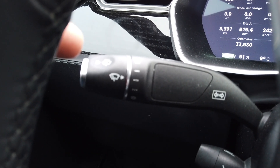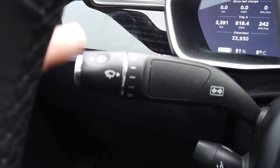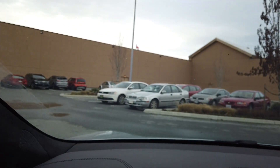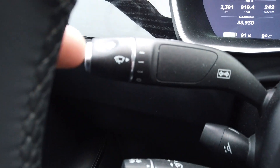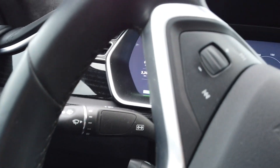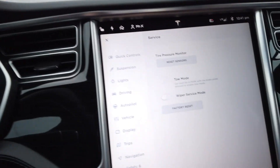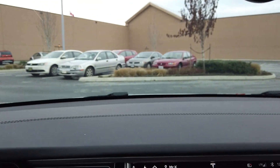The problem is basically this: if you have your auto wipers on — and I tend to forget them on because it's not raining, so the wipers aren't moving, but the auto setting is still active — when that's on, you're gonna have a problem. When you go into wiper service mode, the wiper will not come up.